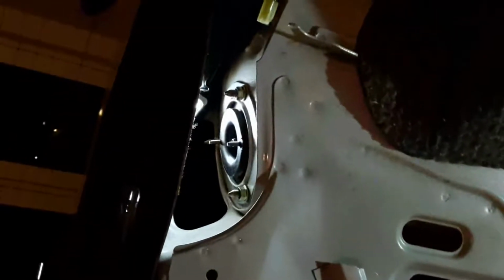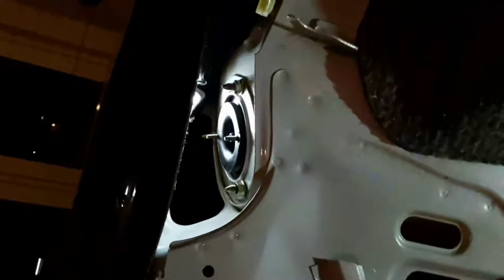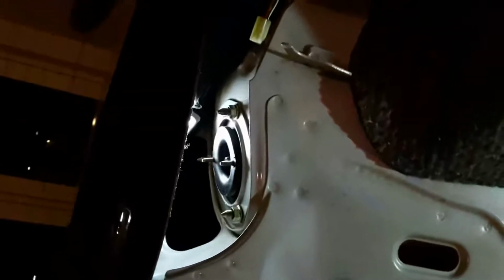It's a tutorial on removing the rear shocks on a second generation Toyota Soarer. As you can see, the strut mounts are behind the rear seat, so you have to remove the bottom of the rear seat and the top, and then you can access this top head over here. You have to lift the parcel shelf too, so that you can remove the TEMS top cap.